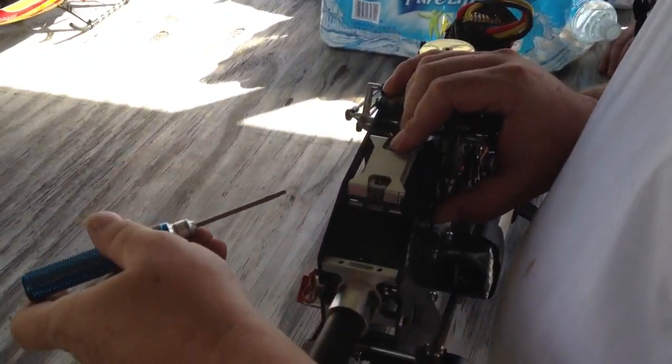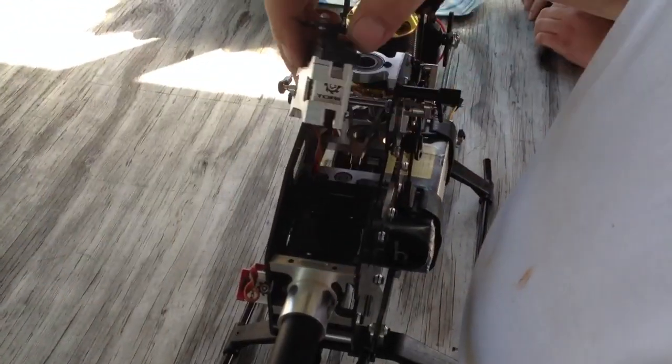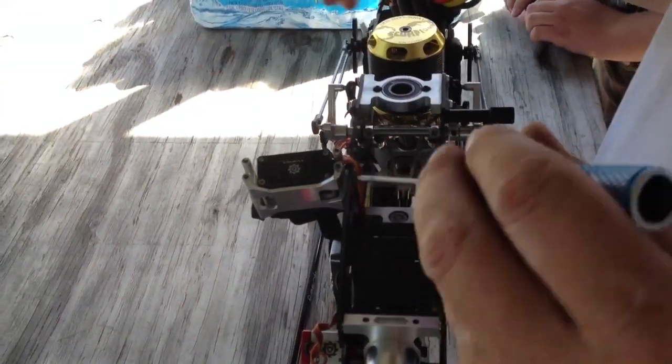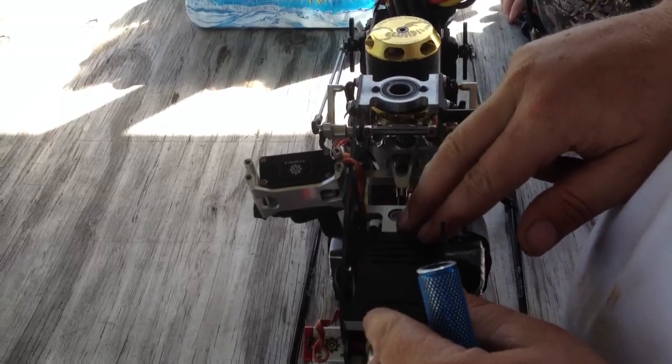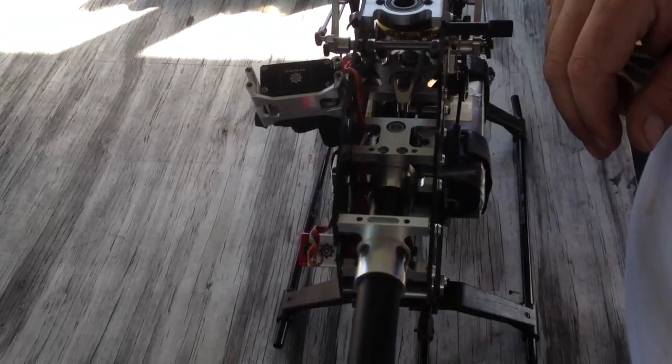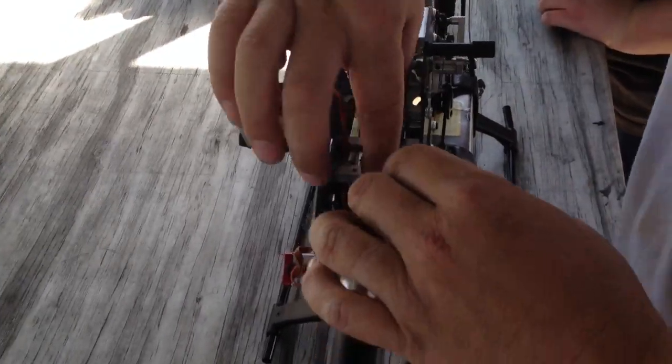So you just pull out these four bolts right here, the servo, pick it over here, and you can lay it over here to the side, which later on I'm going to make a little longer so it's not so much tension on it. You'll take off your carbon fiber plate. I've already pre-removed them, so you don't have to watch the pain. And then you got this plate right here. We're going to pop that out real quick.